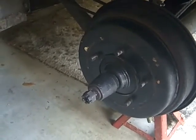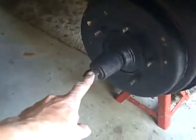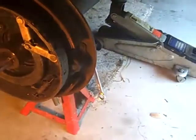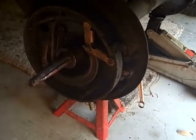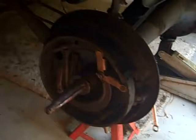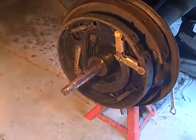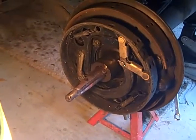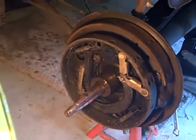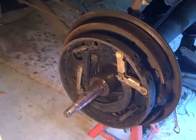I've got the wheel off. I took the cotter pin out and loosened the nut, so now I'll relax the brake 10 clicks. You screw it in that direction toward inboard of the car — you're unscrewing it. It's a simple wedge that you screw out. Then I took the nut off, and after I got the brakes relaxed the hub came off in my hand, so the drum did too. I didn't have to use a wheel puller.